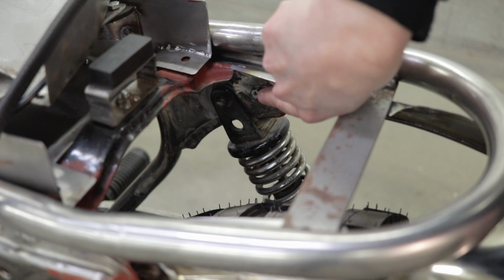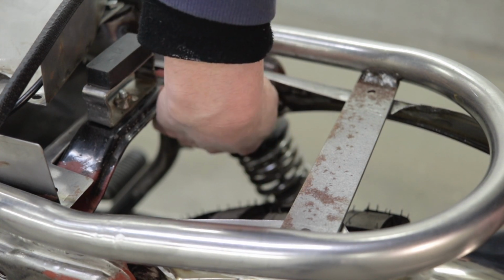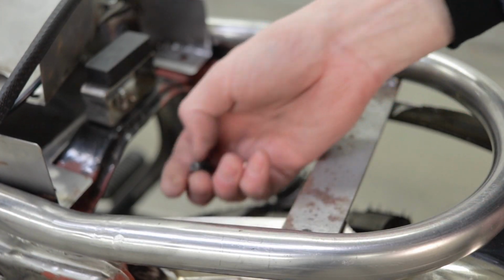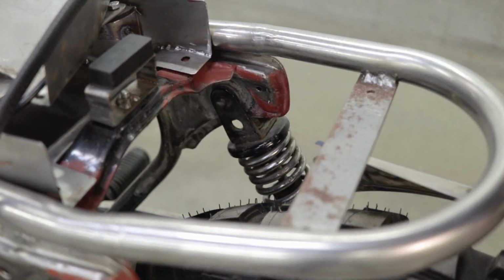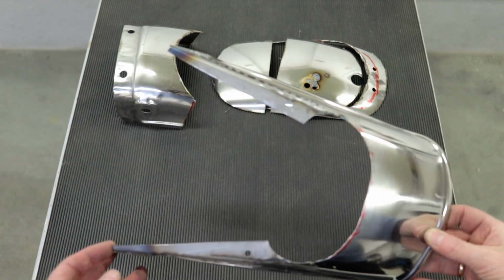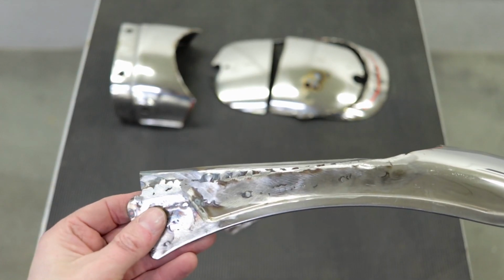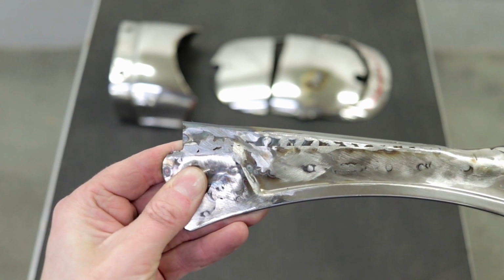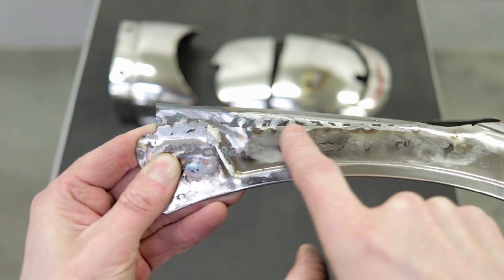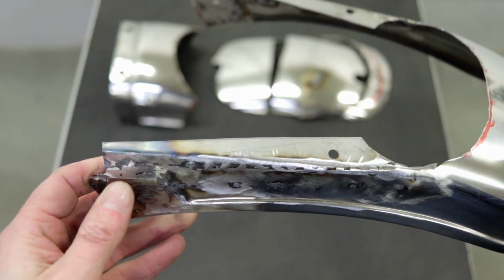I made a hole in the frame right here and threaded it. So you will only see my hand now, but it's easy to take out this 6 millimeter bolt and another one on the other side, and then you just slip it out. And this is how it ended up. As you can see, I had to weld on an extra spacer here. I cut it too low here, so that was stupid of me, so I had to raise it a bit. And then I also added this lip to get it a bit more sturdy,